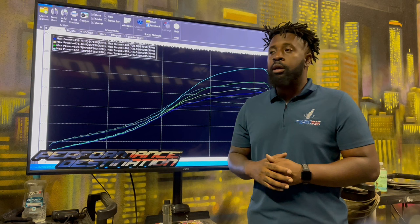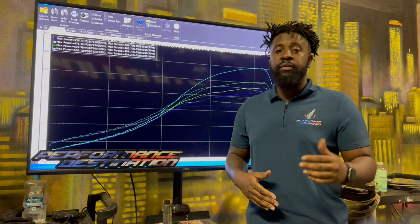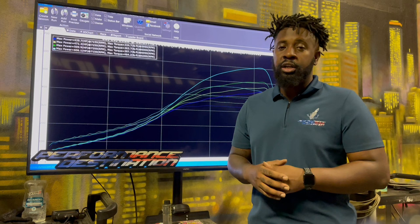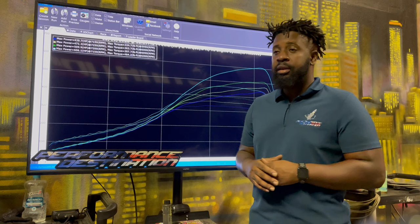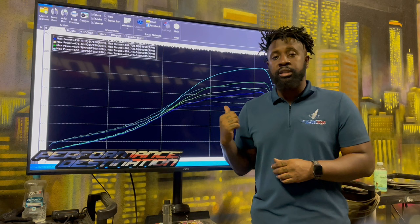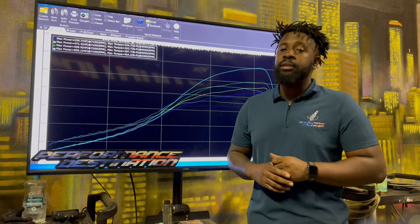And I told him, if this is what your 93 map is looking like, imagine what your E85 map's gonna look like. I told him, I could feel it. This car is gonna make a lot of juice. Even though it's a 6466, a very good mid-to-upper 800 horsepower-ish turbo, it's still gonna feel really, really good. The power band on the E85 is gonna stand up early, and it's gonna moonshine over all the other runs it made. For pump gas, making 606, that is very healthy and very promising.